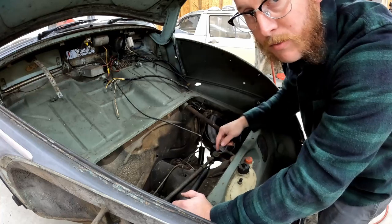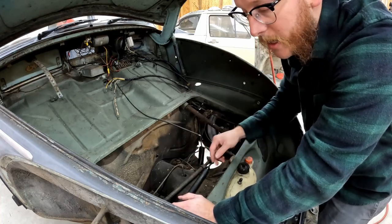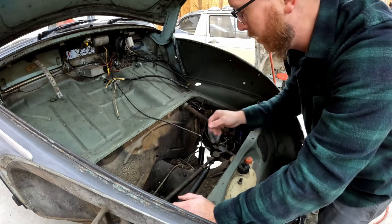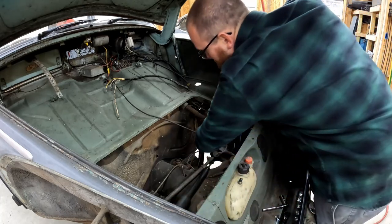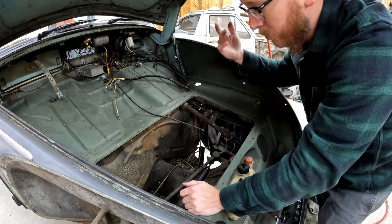So we've got our two big frame head bolts out already. Those are 17 millimeter bolts. I just busted them loose with the impact. Those usually don't seize up in these cars. Those typically come out pretty painlessly. So zap those out. We can unhook our brake light wiring down here. I've taken the clip off of our speedometer cable so we can just reach down and pull that out of our hub. Now it's loose, it'll come up with the body.